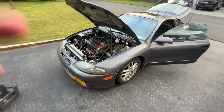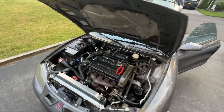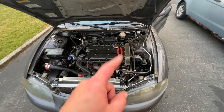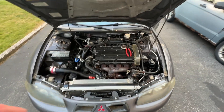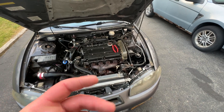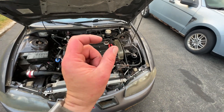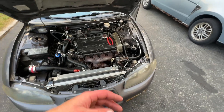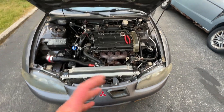What's going on guys, we are out here with the good old-fashioned Eclipse and we have an issue — our wideband sensor. I have an AEM Series X wideband and over the last few days, once I get it on the highway, the gauge starts giving me just dashes, which means the sensor is either reading faulty or there's something wrong with the wiring.